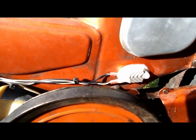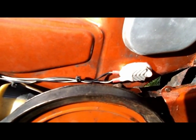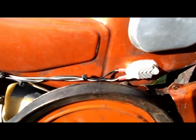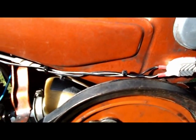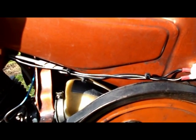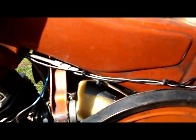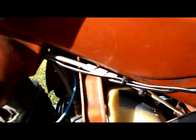The two cables: one comes from the contact breaker points and that provides the switched ground, and the other one goes back to that terminal block I showed you earlier which feeds the LT ignition side of the circuit. The cables are just tied using tie wraps and fairly carefully routed so hopefully there's not too much rubbing or any problems. They go up to that terminal block by the ignition coil.